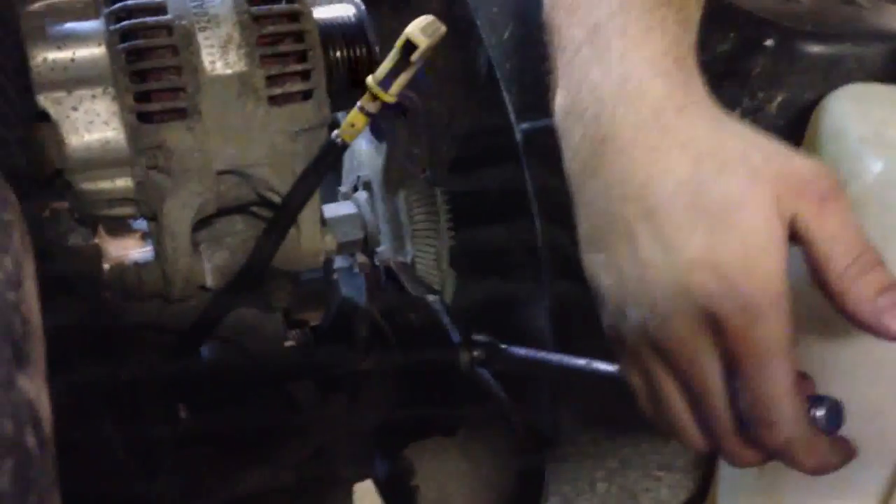Here is a side view. Michael just pulled the tensioner with the Johnson bar — see that? That'll loosen that right off and the serpentine belt will slide right on. It's an automatic tensioner right there. Now all you've got to do is back the tensioner off, put the belt around the tensioner, and we'll be all ready to roll. Michael's got it all figured out. We're a little bit short right here to get it past this pulley, so Michael's going to put the Johnson bar on there with a 15mm socket, crank that over this way, and when he does that, watch — the belt will just drop right on there. It's on there. Everything looks good all the way around — we're ready to go. That is already pre-tightened up right there.